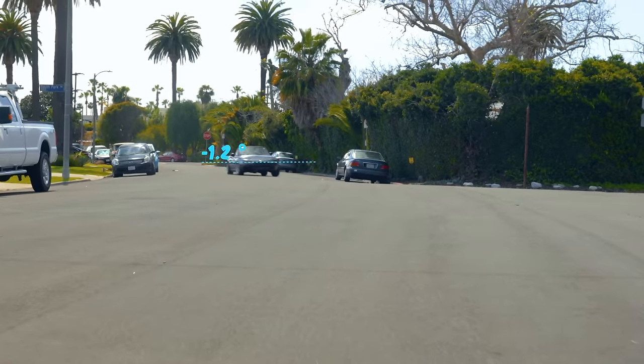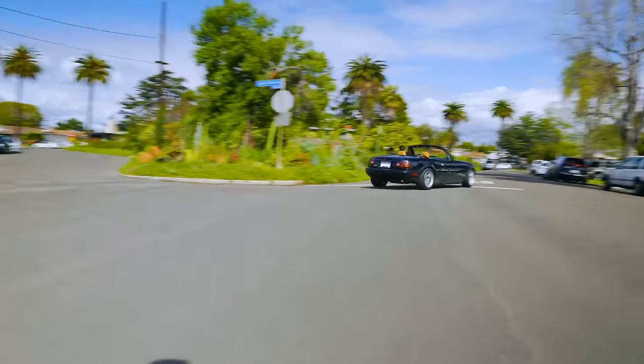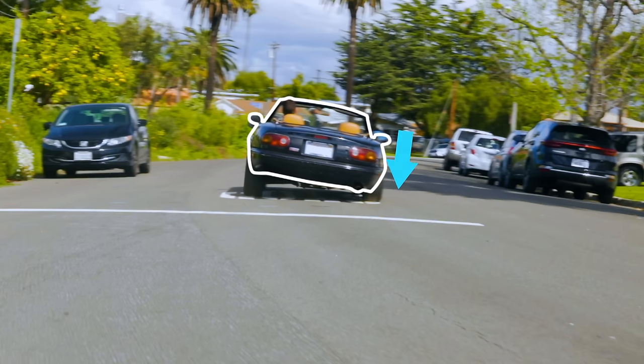So the job of the suspension of a car is to absorb bumps and potholes and make driving comfortable. The problem is that auto manufacturers usually make cars too comfortable and cars end up being really squishy and soft. Take a look at all the body roll on the Miata. On the stock soft suspension, the forces of the weight of the vehicle in the corner just squash the outside suspension, allowing the inside suspension to stand up.